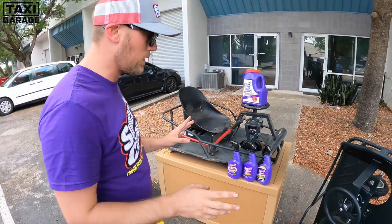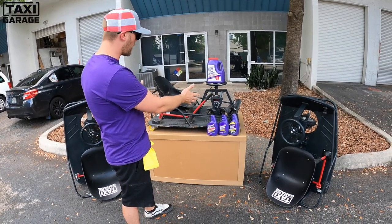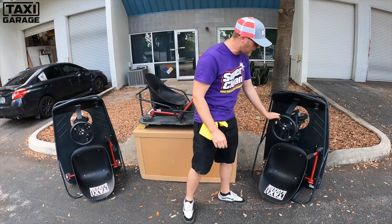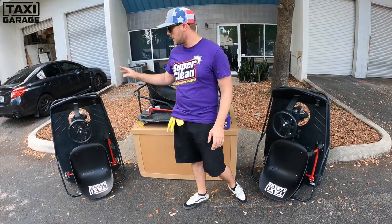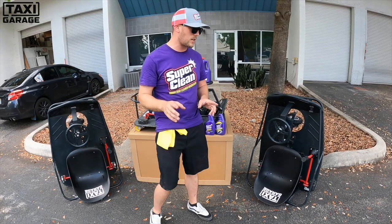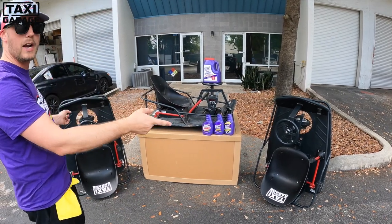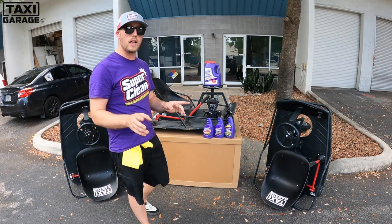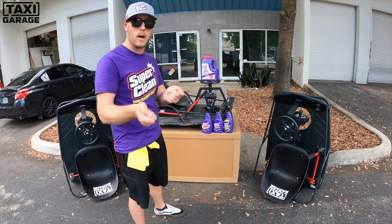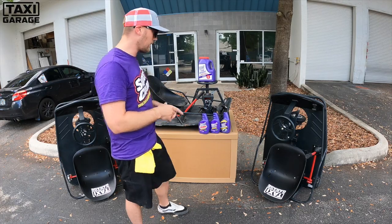Basically, what we wanted to do is show you every level of XL that you can have. So we're going to have our 1000 watt 48 volt Mac Daddy cart. We've got Charlie's cart here, which has our upper 11 tooth gear on the factory 500 watt motor with a 45 lower. And then we have my cart here, which has an 11 tooth upper and a 40 lower. All of these are going to be running TG solid tires, and they're all brand new, so they have that same comparison there. Ryan's running our casters, we're still running factory casters, and in this box right here is a brand new OEM right out of the box XL. It's charged, we're gonna yank it out of the box, and we're going to do a comparison of all three of these. That way you guys can see exactly what is what.